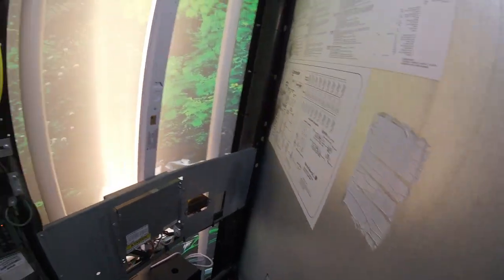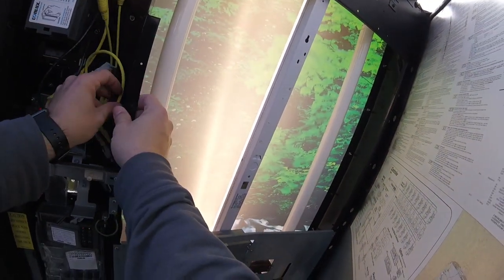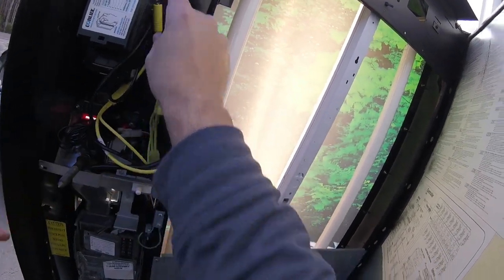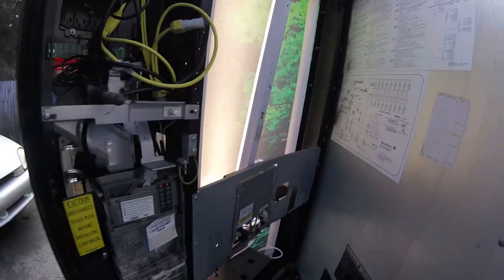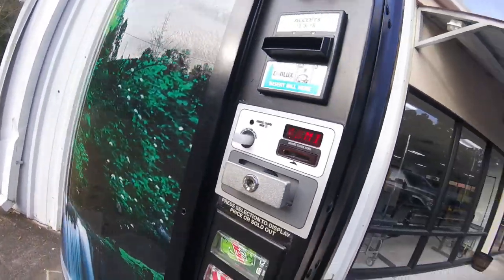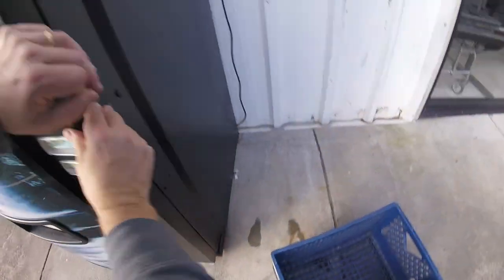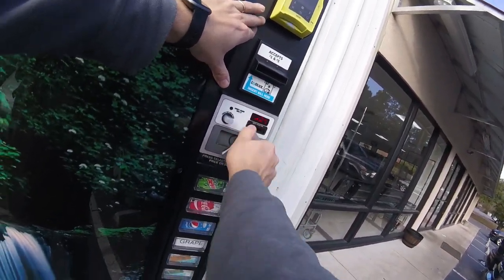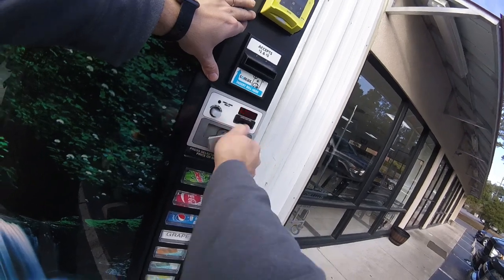JC10 is still showing and we don't have a column 10, but I'm going to go ahead and mark this as solved because we did clear the jam on column 4 and that's good to go. Everything else has had sales recently with no other issues. Just know that I still have that flashing decimal point on the display screen, which means there's still an error — and the error is JC10 — but we don't have a column 10. I'll leave it for now. This was a bonus maintenance video, a little different from the usual service or collection video.